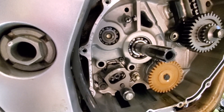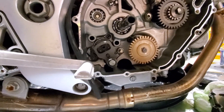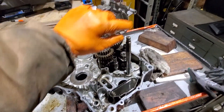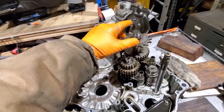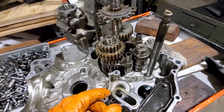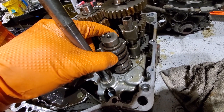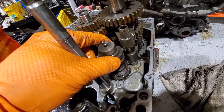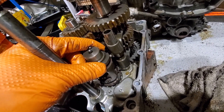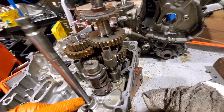Let's look at it from the inside because there's not that much we can see from the outside. Here's what it looks like from the inside. You've got the shifter rod - shift linkage would go on here. You have the output shaft, driveshaft for the sprocket. You have the intermediate shaft. Here is the shifter barrel cam - or shifting cam, gear selector cam - shifting barrel is a perfectly fine way to describe it. That moves the shift forks - these guys - and there's three of them: two on the drive shaft, one on the countershaft.